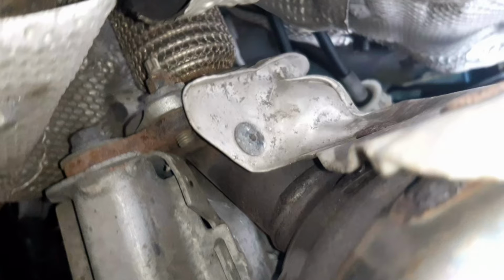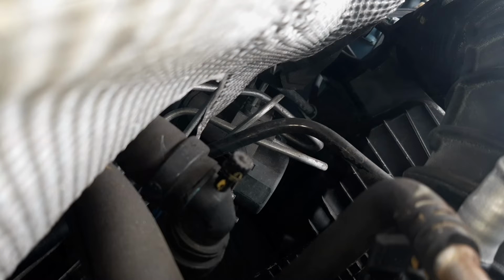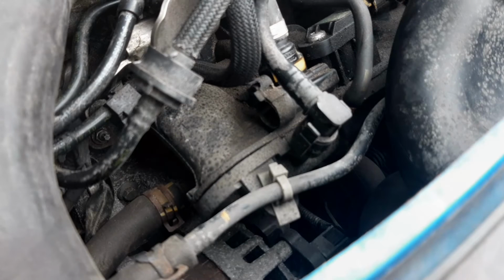Also in the back of the engine compartment, you have your flexible pipe for your exhaust system, transmission selector cables, and other components. Moving forward from one of your bleed nipple covers on one of the coolant pipes, you have your ABS modulator. The ABS modulator is used to prevent the wheels locking up during hard braking, but it's also used for other systems.